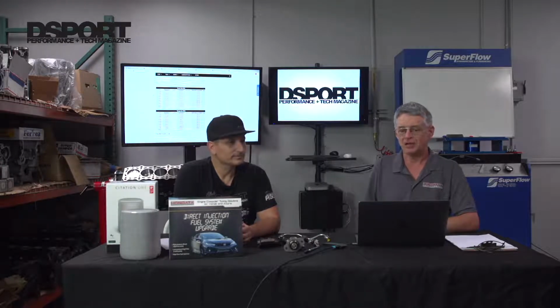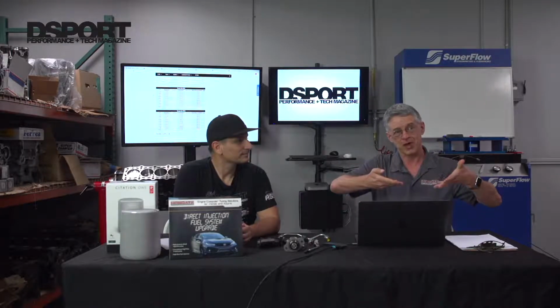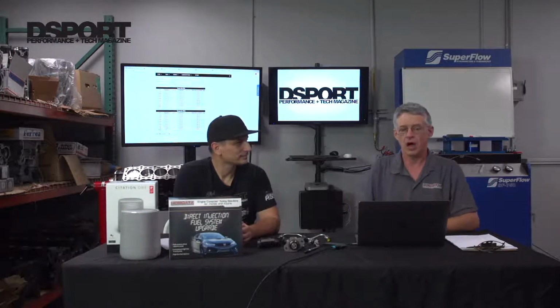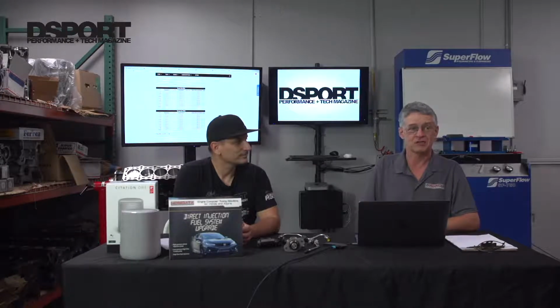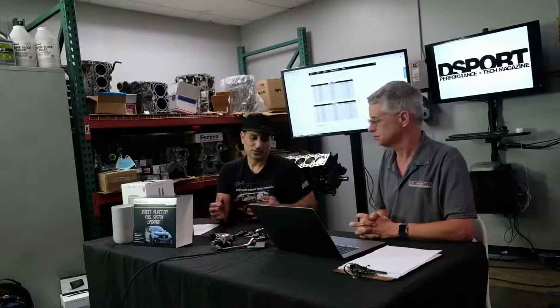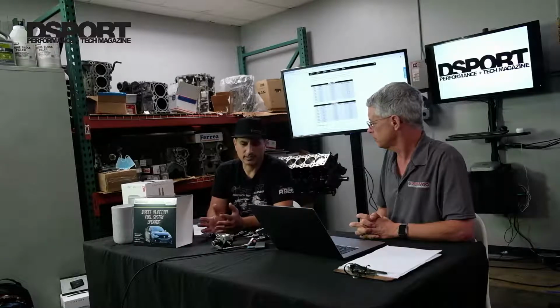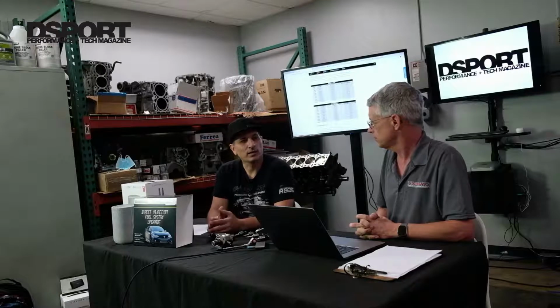That's it. And Honda are pretty smart with their cam control, so that they provide enough overlap so that some of the fuel gets washed back into the intake and it washes the back of the intake valve. So I've not seen on any of the engines that have done any large number of miles a necessity to have port injection. Now, port injection, if you're going beyond this level, let's say you want to put together a Type R engine and make 550, 650 horsepower.